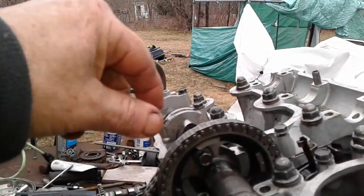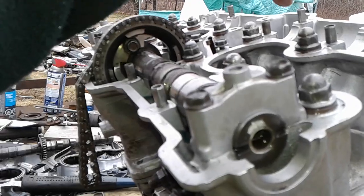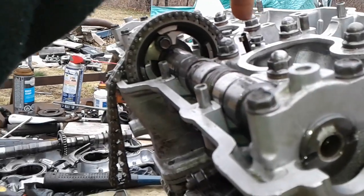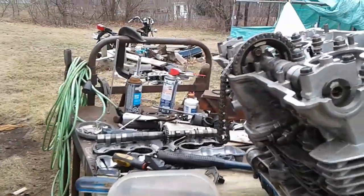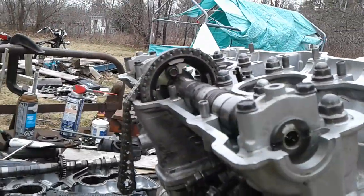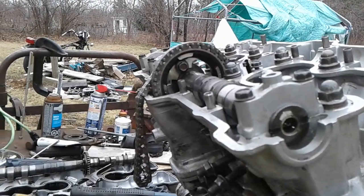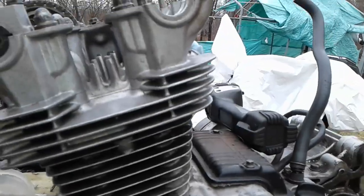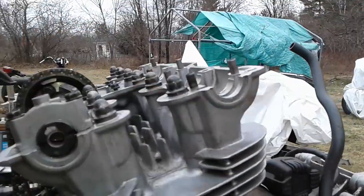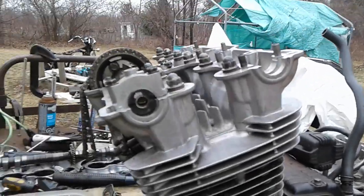See that — it's a fair amount of slack. After I tighten that, I'm going to undo the tensioner. Then I'll have to roll it over three or four times to make sure it's got all the slack taken up. That's pretty much how you fix that. Once I get that settled, everything else is a cakewalk, and that'll pretty much be it for today.